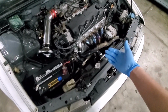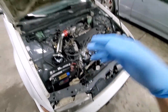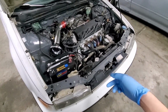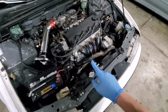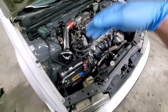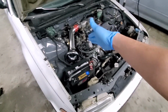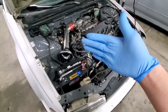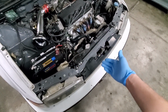And both me and James highly think that it's this radiator. See, this radiator was in the car when it had the messed up head gasket, and we think maybe they put some stop leak or something in it, which is a major no-no. And for that reason, it's probably clogged up some of the fins so it doesn't flow properly. And what I did was I took the thermostat out because it was rising to 3/4 and it was scaring me, but I didn't even realize that it probably wasn't the thermostat anyway. It was probably just mostly the radiator.